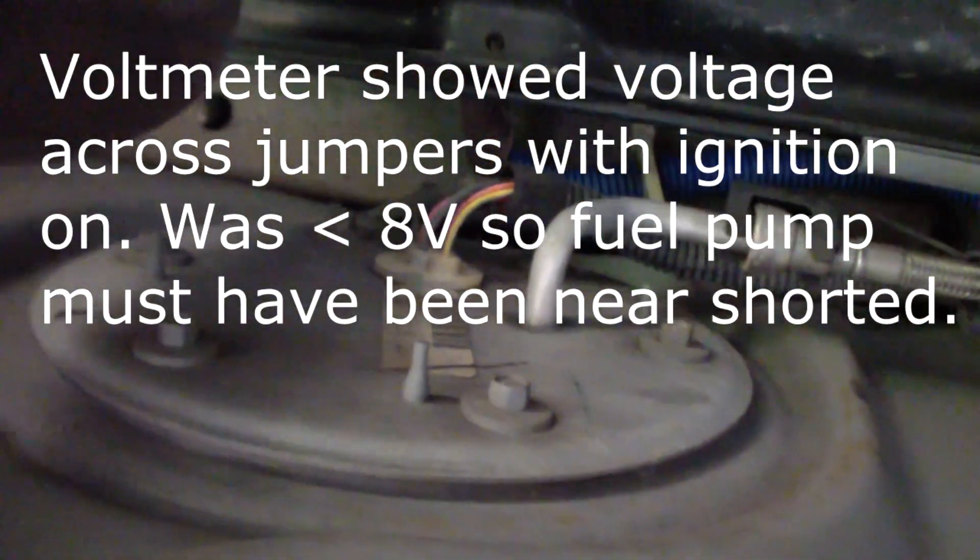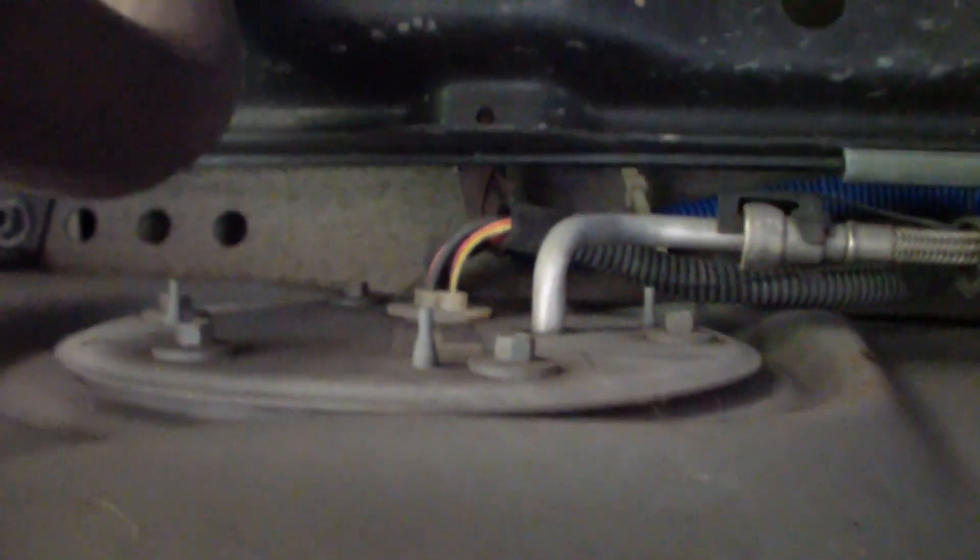Here's where the fuel pump resides. It looks pretty good and clean, and there's the exhaust pipe right here. It looks like I could possibly get this thing up, move it over, and get it out without even touching the exhaust pipe. Looking at other videos, people either removed a couple of strap hangers to move it over an extra inch for clearance, or just took a ratchet strap and strapped it over to the wheel to force it out of the way using the rubber hangers. I pushed with my feet and pulled the strap tight, giving us an extra three-quarters of an inch of clearance, so I should be able to get it out.